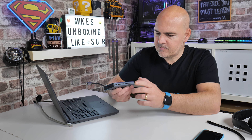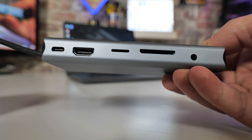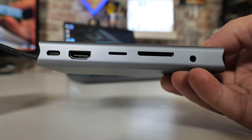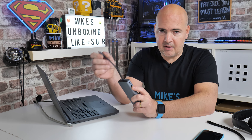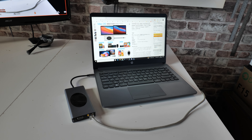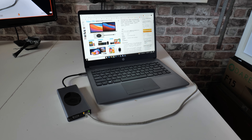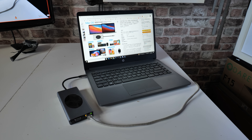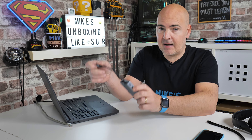Next to that, we've got an HDMI port supporting up to 4K 30Hz. Now, this isn't going to magically give you an HDMI port on a device that doesn't support USB Type-C with video output. That is something very important — you have to have a device which supports it. This laptop here, our HP 245 G8, has a USB Type-C that is data only, so it doesn't provide power, doesn't accept power, and doesn't give a video output. It doesn't magically give you HDMI output if the chipset doesn't actually support it.